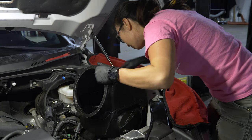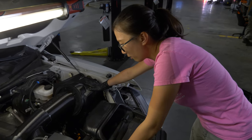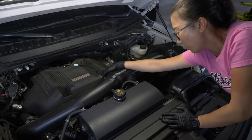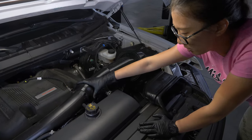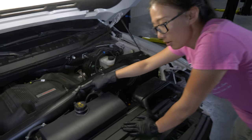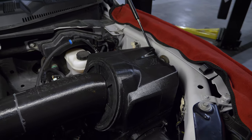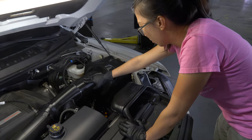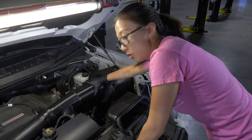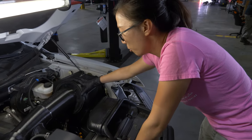I'm doing a test fit to check that everything fit like it should. This intake for the F-150 can be broken down into several components. We have a roto-molded airbox and a roto-molded intake tube with the intake air temperature sensor on the back, plus a small adapter. We have two silicone couplers — these are pretty cool; we printed these with a flexible filament so they actually act like rubber, giving us an accurate representation of the silicone part we're going to produce. We also have a rubber grommet that connects the intake tube to the airbox, providing ample flexibility — when the engine is moving and the intake is moving, this rubber grommet absorbs all that flex so we're not risking ripping the intake tube out of the airbox.